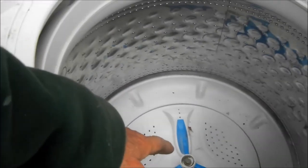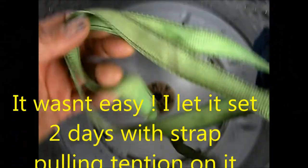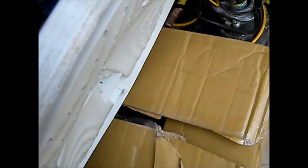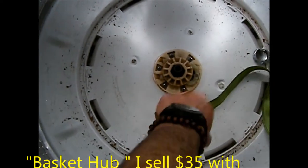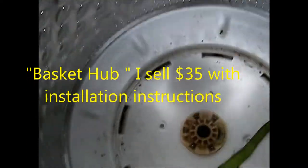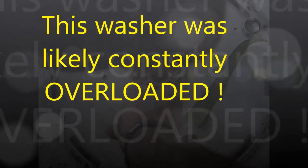It's actually fairly easy to fix. Basically I tied the strap underneath that. Heat gun. And we can see — lift up on the drum, you can see there's slop going back and forth. Basically we need this piece here. The pin holds it in, screws hold it in there. Once we replace that, it should be good.